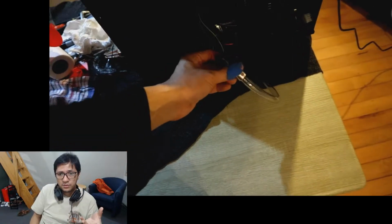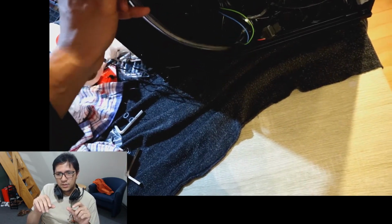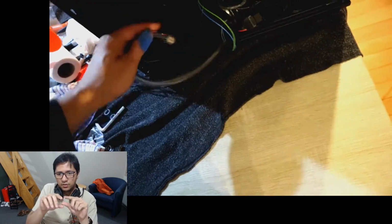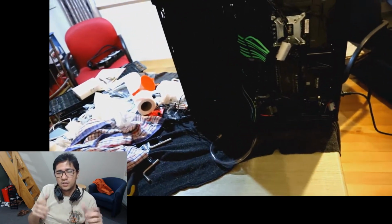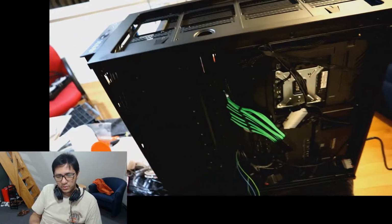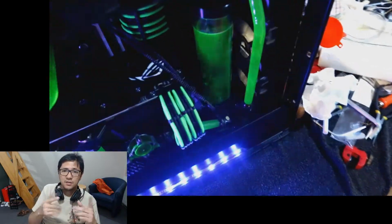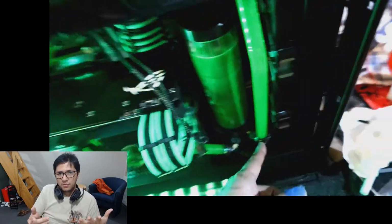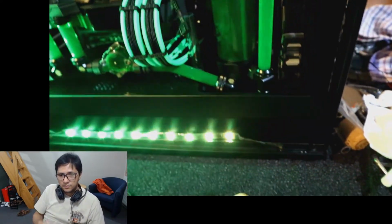That posed some issues when we were bending the PETG tubes, because since there's a lot more space inside, the tubes tended to have a flat side, so the bend was not as perfect as I wanted it to be, but at least I was still able to manage to get a good bend out of it. And we didn't have the 90-degree bending guides and everything like that, so I was bending everything by hand, trying to figure out the bends properly.